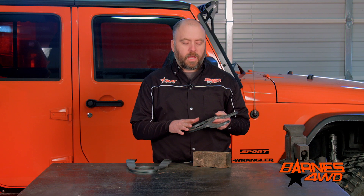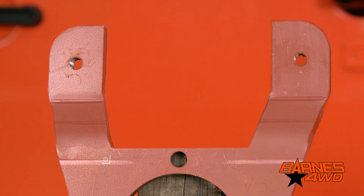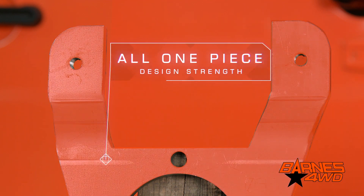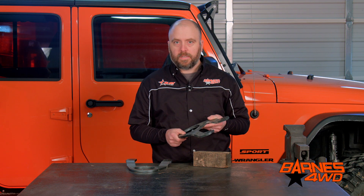We really feel that making this bracket out of one piece of steel with this bend is a superior design to having a flat piece of steel with a bolt-on spacer. Disc brakes are a great upgrade for your trail rig — they're going to shave a lot of weight off your rear axle, increase your stopping performance, and they're not going to get full of mud like drums will.